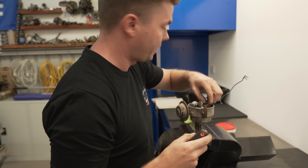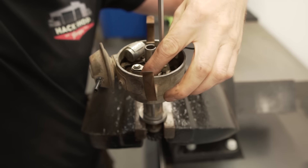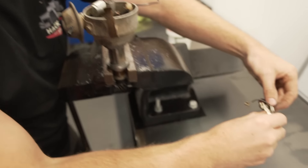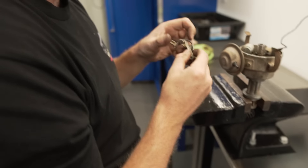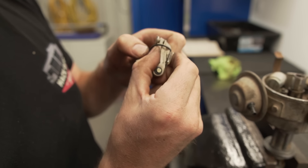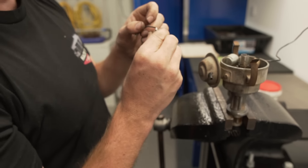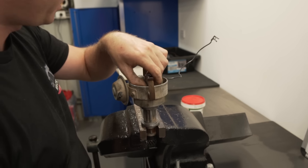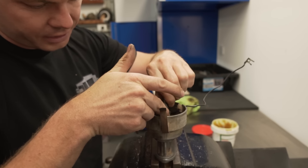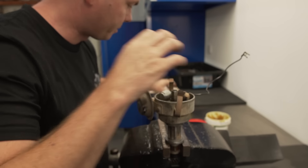I've done a little bit of reading in the book on how to do this. So these are your points here and this has to come out. Pull this out now and hopefully don't drop that very tiny delicate bolt. These are the old ones - apparently when they fail, they pit. There's a big pit mark right in the middle there, and you can see where there's a mark where it's like transferred over. So this genuinely could be the problem. We'll replace that and swap it over. One thing it said is to put a little smidgen of high-temp grease on the cam - that just stops it from wearing the cam.